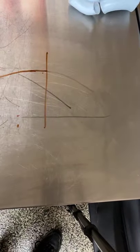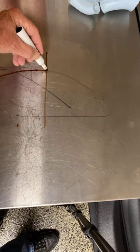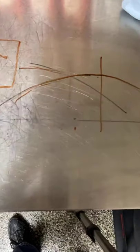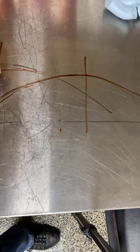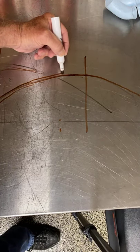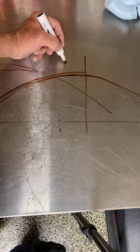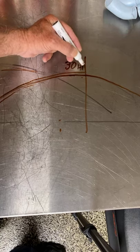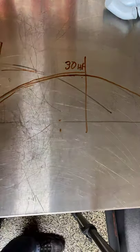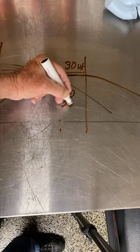Well, without the vacuum pump and just really nice pistons and really nice rings, our horsepower curve kind of looks like this. And if you put a vacuum pump on this same engine on the dyno, you see a gain here. You see a little gain here, and you see a little gain here, and you see a little gain here. And when you finish dynoing, you say, I picked up 30 horsepower with my vacuum pump. If it's a pro stock car or a really fast V8, if it is a pro stock motorcycle, you might pick up 10 horsepower or maybe 20 horsepower.